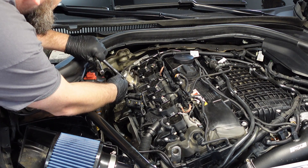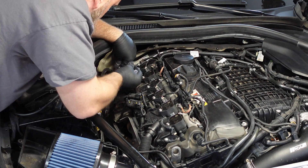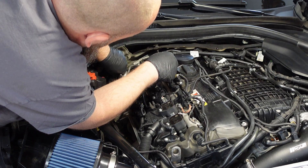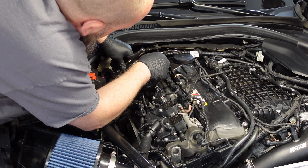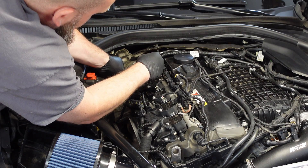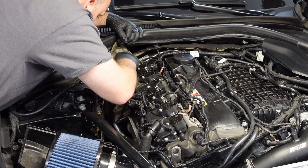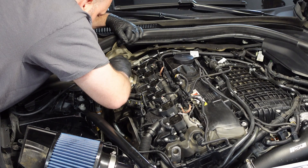T30. For these ones, be a little bit careful — last thing you want to do is break one of these. They're not torqued too much, lighter than a spark plug. Because this is sitting on the cam lobe, you're going to want to loosen or take the tension off slowly. So there's three ratchets, three more, and then we're going to go to the back again. Three more — alternate until the tension is taken off. So that's finger tight there. As you saw the one on the bench, there's a big spring in the middle of it. That spring ends up riding on the cam lobe. You need to take the tension off evenly and equally to not have it spring off or get bound up. It's pretty loose now, so it's just a matter of taking the screws out.